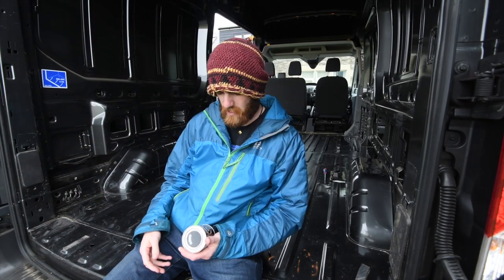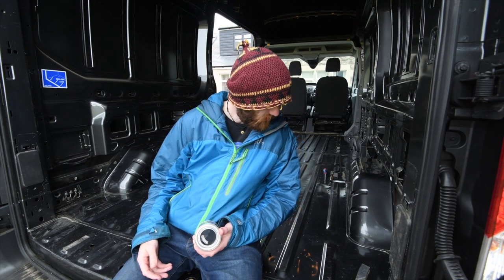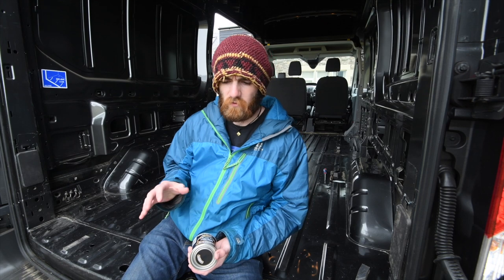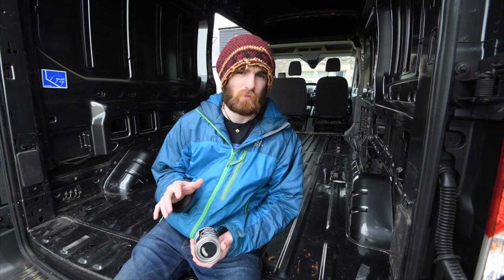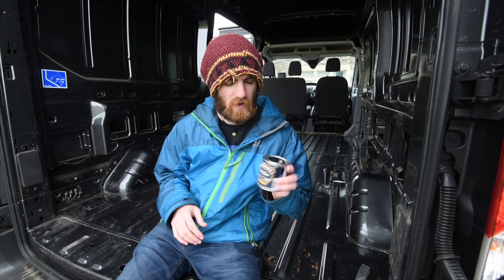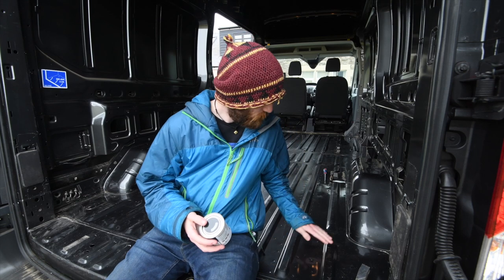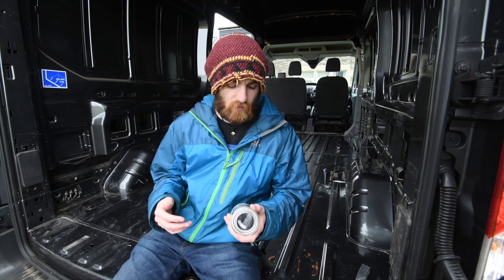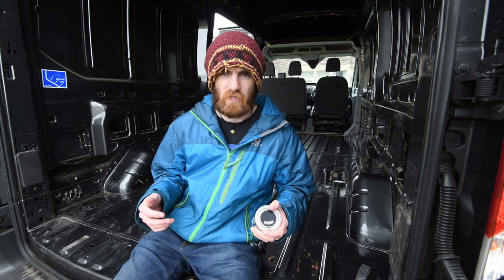It's a new day, and I was thinking about the Hammerite Krust stuff I was using yesterday. Although it's great at converting any tiny bits of surface rust, it's not really going to protect it that much. So I've gone out and bought some Hammerite Direct to Metal paint, which will act as the top coat. I'll do a few layers of that to protect all the scratches, and then it'll be on to patching all the holes. Let's get going.